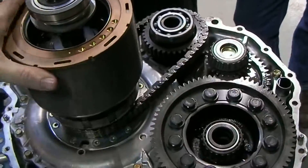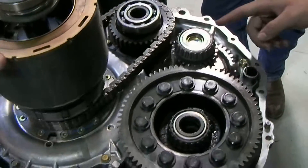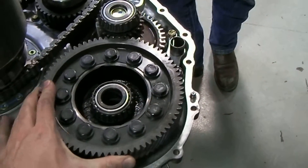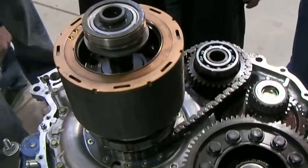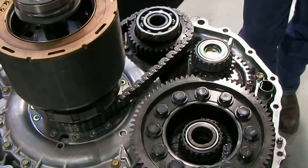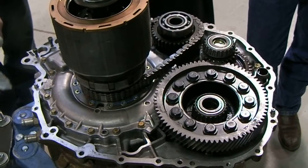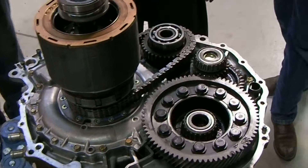This is MG2. MG2 is our primary traction motor — when it spins you can see the way it turns the whole drivetrain. When MG2 is acting as a generator, our differential is turned by the CV axles which are turned by the wheels, and it pushes everything back the other direction. Much, much simpler than a regular automatic transmission. It's kind of an interesting design.